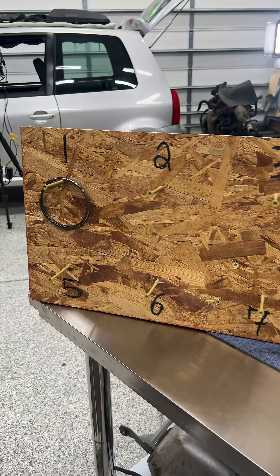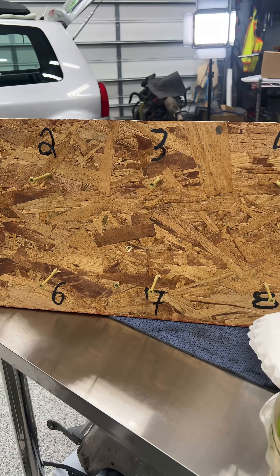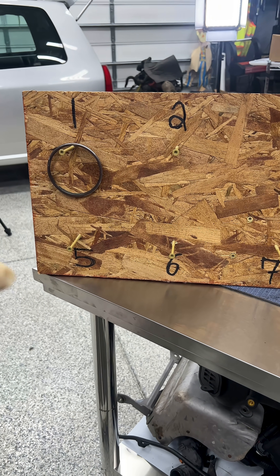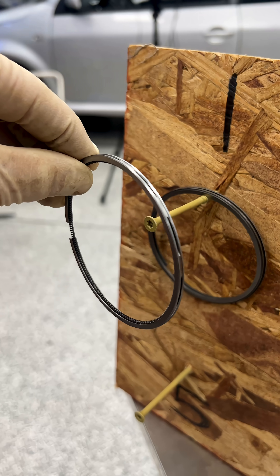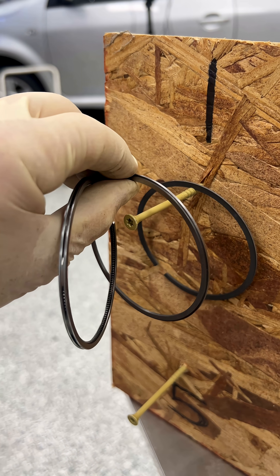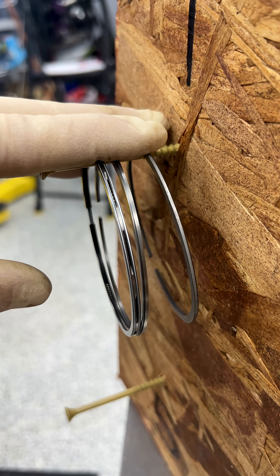This is something I want to share with you guys today — this is a board that I made for doing the piston rings. We only have five so we got some extras, and hopefully I'm smart enough to not throw it away like I did with the last one. This allows me to organize my piston rings: I can clean them, lubricate them, and hang them in the order I'm going to install them. Oil control ring goes first, middle compression ring second, top compression ring third.